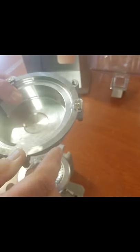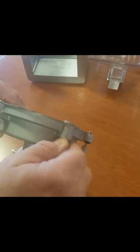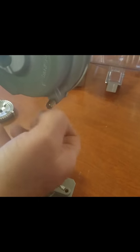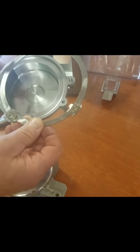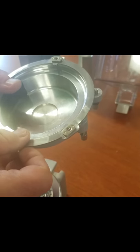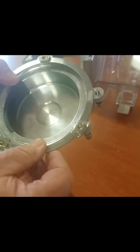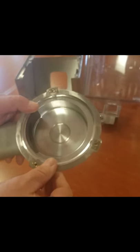You have your locking ring on here. To remove that, you have three more thumb screws — you simply back those out, and the screws do not come all the way out. And this locking ring comes off for cleaning. When you go to put it back, you can see these little nuts on top — those always come to the outside facing you, never with the nut side down. Also, these holes are not evenly spaced, so it's very specific how it goes back on.